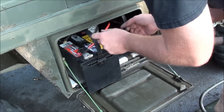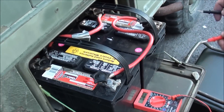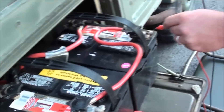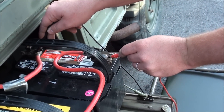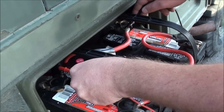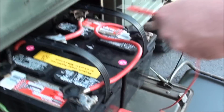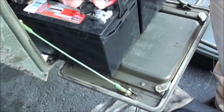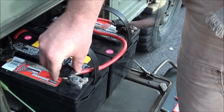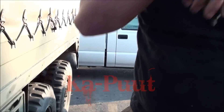Okay folks, we're pulling the batteries out now. Zach, you get them on the right. They're Kirkland - not a name brand, but they're Kirkland. Negative 12.2, that's the truck running. 11.7. That's not very good contact - let's get some copper. There we go: 23.9 with the truck running. So here's the test we did the other day when we were trying to decide what was going on - I just pulled this terminal, and theoretically it'll keep running if the alternator's running it. And no - as soon as that wire comes off, it's kaput.